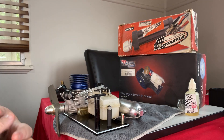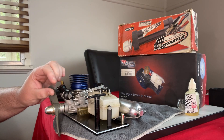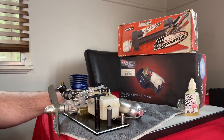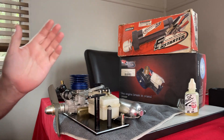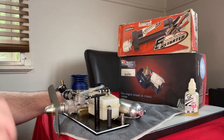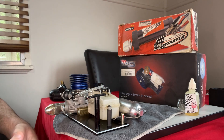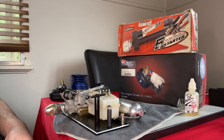As you can see, I've had this bench for a long time. After you've run the engine for a while and you're in the cooling-down phase, it's vitally important that you keep the piston at bottom dead centre. As the metals start to contract, you don't want it at the top of the stroke. That's about it really. I just wanted to thank everyone for taking the time to watch. If you've got any comments or feedback, feel free to leave them below. I hope this addresses some of the confusion — maybe because the oil bath is a new concept and people are a bit set in their ways or reserved towards it. I just wanted to go through things in a bit more detail and hopefully address any concerns.